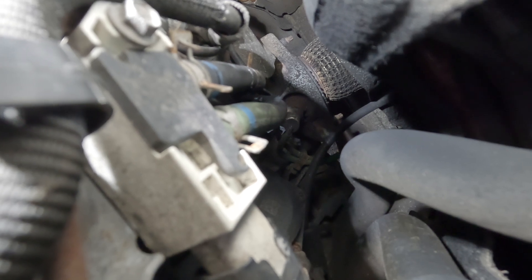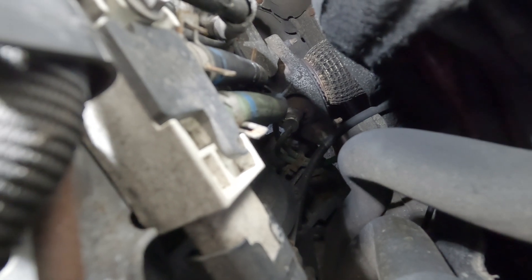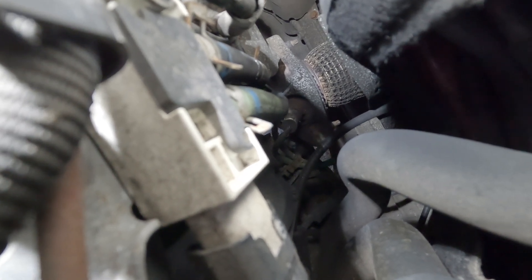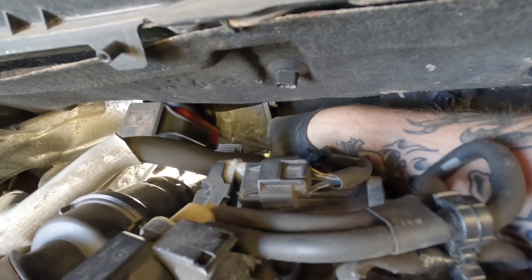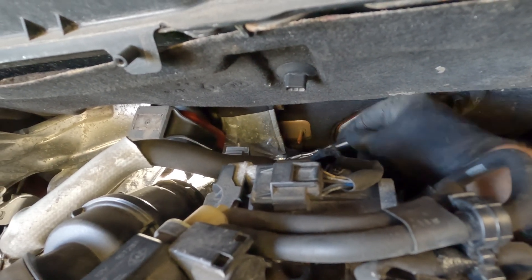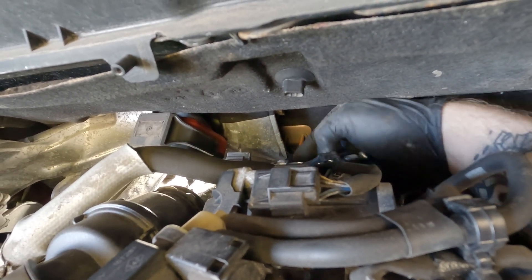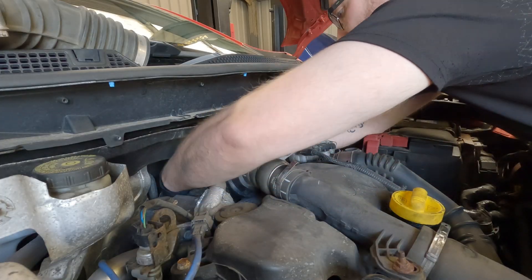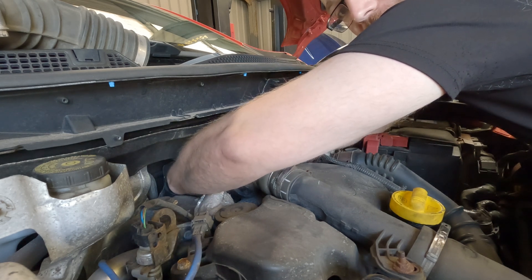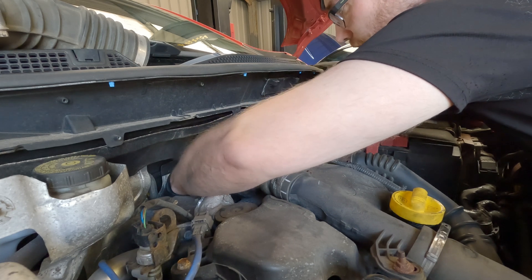There are those two pipes that you can only just about see. There's going to be a little bolt holding on that sensor, so we're going to have to undo that, undo the electrical connector, and then get that sensor out so we can have access to those pipes. With this pipe out of the way, you can put the ratchet around. Because of the positioning of it, you can't see it directly, so I'm using a 7mm to try and disconnect the sensor from that frame. Once you've undone the bolt, gently guide it off by hand — you don't want to drop this.